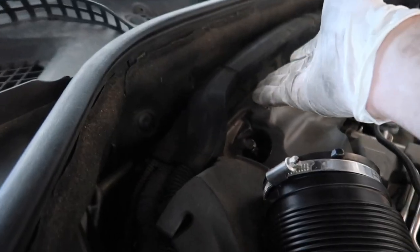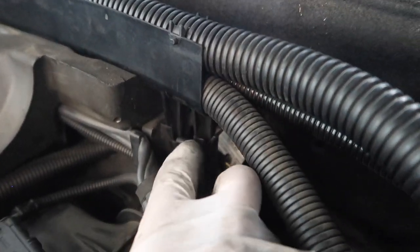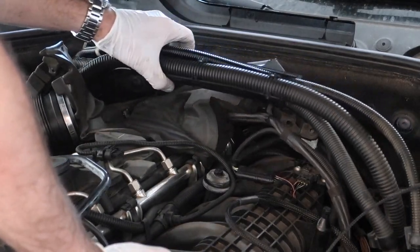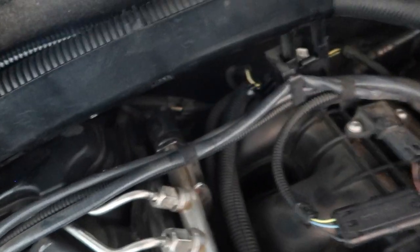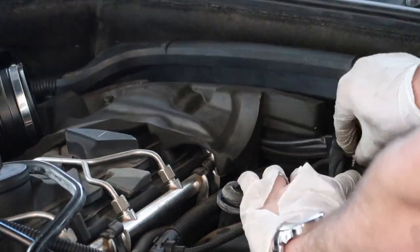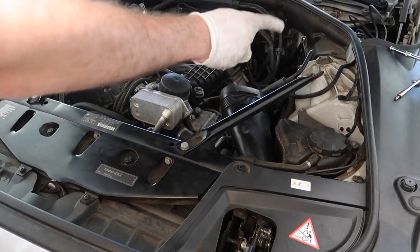To access the fuel sensor, move this rubber piece out of the way to expose three bolts — I believe they're T25. Remove those three bolts, then on the other side there are two more screws; remove those and this whole piece lifts out of the way. The sensor is literally right on the back at the end of the fuel line — just unplug it and do the same thing you did with the other two sensors. Since my car is a pneumatic variant, I don't actually need this connector, so I just tuck it down. Now put the intake back in and start working on the cabin.